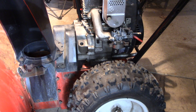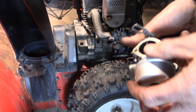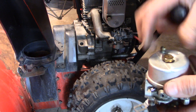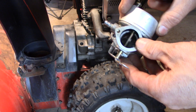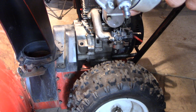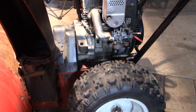Put a new carburetor on — easy peasy, 10 minutes. I'll put the shield back on and that's it. Way easier than trying to adjust or clean. There's no adjustment on a fixed carburetor. To clean one of these you'd have to take it apart, send a wire up there, blow everything out, carburetor cleaner — but honestly, why? For $13, just put a new one on. Right out of the box, the thing works great. Thanks for watching. Simple stuff.